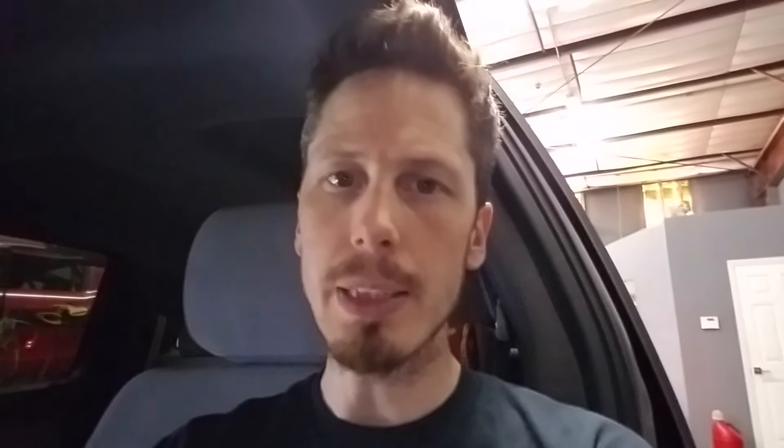What's odd is that air-fuel is good, the additional fuel injectors are working, and we are dead on the money meeting our target. But the PCM still thinks that fuel pressure is too low and it's closing the throttle to limit power. I went back to look at some comparisons and I have F-150 logs from my truck when it was making over 600 horsepower — the fuel pressure drops lower than what EcoStang is dropping to and the throttle stays wide open, making way more power without extra injectors. Doing some comparison trying to figure out what exactly is the difference. It's a big mess but we're working at it, and we don't really have a choice — we need the throttle to be open. Lots more work on the to-do list. Not checking things off, only adding things.